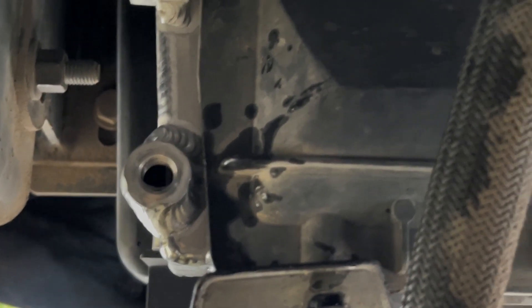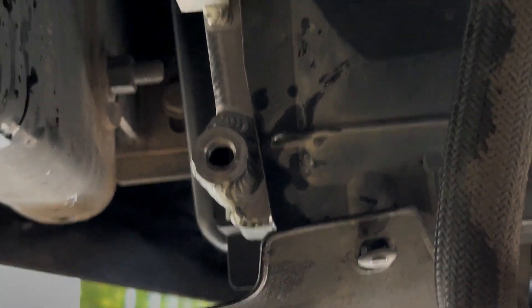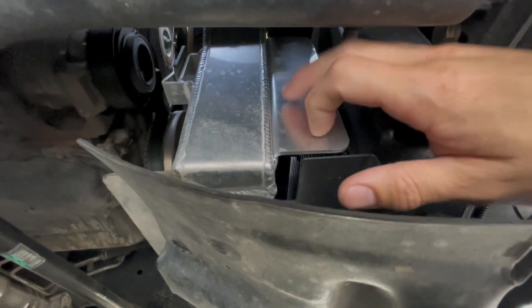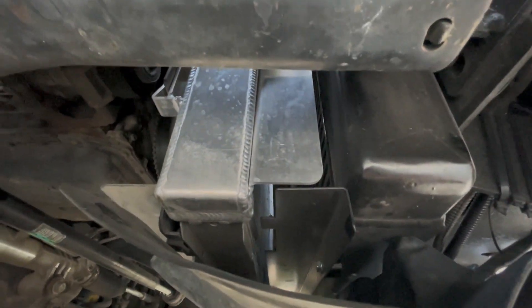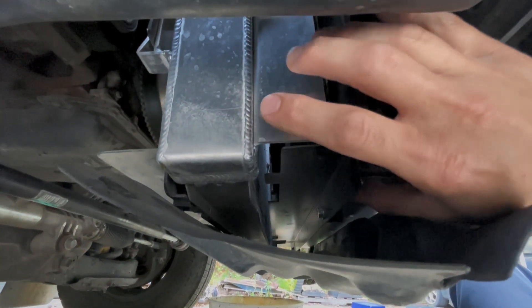There's the drain port — it drips right down and goes right into the bucket. Everything sits well; there are no real issues. It went in smooth just like the stock one, though it is close on some of the fitment. It takes up a lot of that dead space from the stock radiator, and it has welded-in side plates to keep air drawing in. With the Mishimoto intercooler and the bracket they send with it, it creates a vacuum and draws air really well.